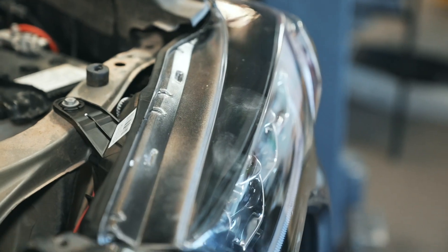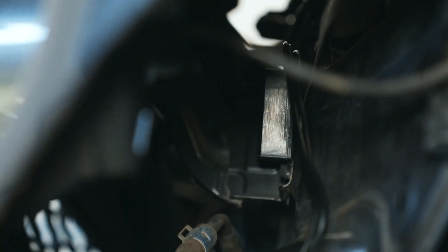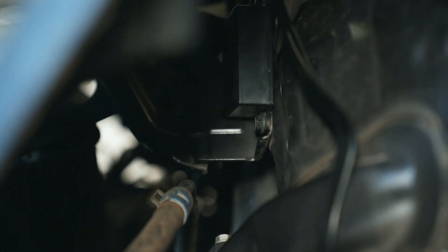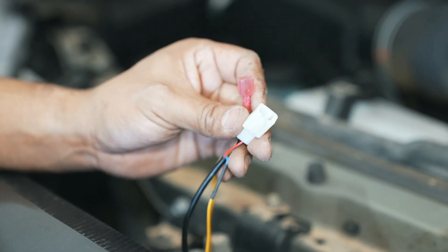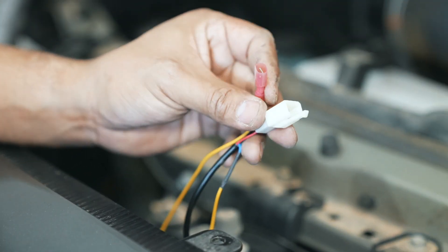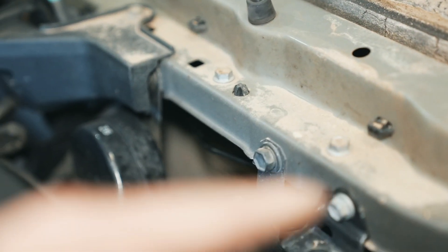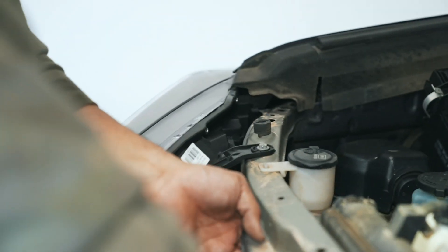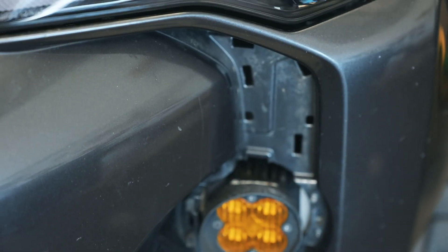Just look directly down — there are a couple of 10mm bolts you could use and we basically just picked one. Here's what it looks like from the bottom: there's the module and the 10mm bolt we used. There are two wires that we need to run to the passenger side. One is going to plug into the actual DRL itself, and then the other one will have a yellow wire with a tap on it. Run that behind this channel right here, go behind everything, and then over to the passenger side headlight and come down to where the actual DRL bezel is going to be.